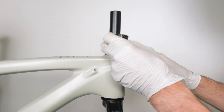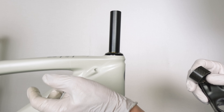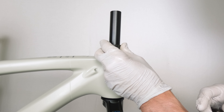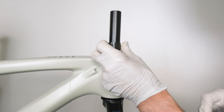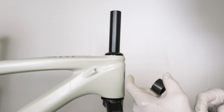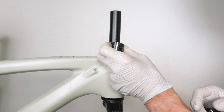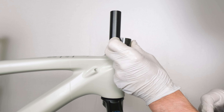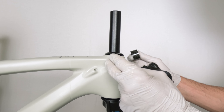What I do at a minimum is put in a 20 millimeter spacer. 20 millimeters should be more than enough to figure out a range that will be most comfortable. When putting in spacers, we are reducing reach — it's a three-to-one ratio, give or take, depending on the head tube angle. For every three millimeters up we are moving one millimeter in. So 10 millimeters up is about three to four millimeters in; 20 millimeters up is about six to eight millimeters closer to the seat.